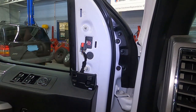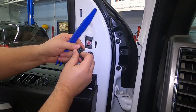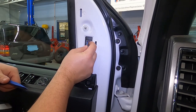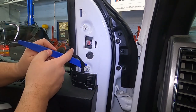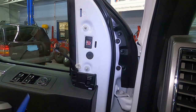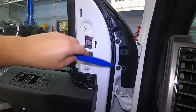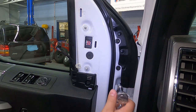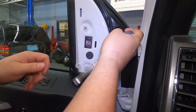What we're replacing here is an 8-pin style. To take out the connector, there's a little lock tab — push in on it to release the barb and pull it out. The harness sits on a little stud, so pop that off too. There are four fasteners: two nuts and two bolts, all 10 millimeter. Use a 10mm socket on an extension and go through and take them all out except for one.